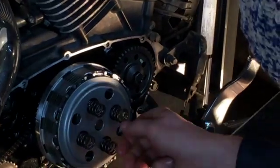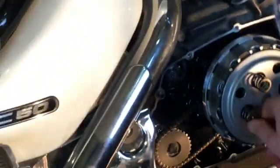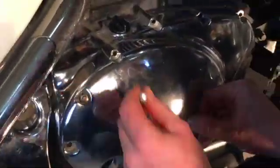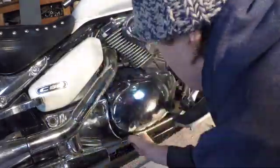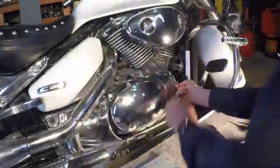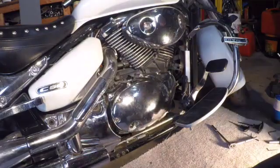And this is one of the tricky parts. I usually use a star method to put them in. And they have to be, I believe, 7 pounds pressure. I don't know if you can see right down here. It shows that it will use 3,000 milliliters. So that's 3 liters. So I have some oil set aside, and then I'll just put it back in whenever all the parts are back in.